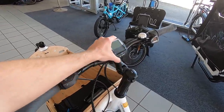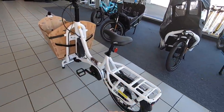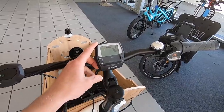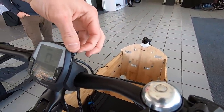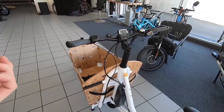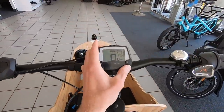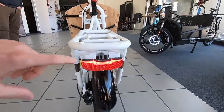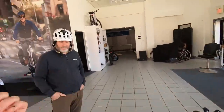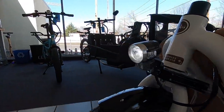These are some of the fancier parts on the bike that could be a bit more sensitive. I love that in addition to the motor, both the headlight and taillight run off the main battery pack, and they're pretty bright. Let me power it up quickly — it comes to life fast. This display has a micro-USB port on the side for charging an accessory, though it's only 5V/500mA versus 1,000mA on the new Bosch Kiox, meaning you can't charge some iOS devices. Press the light button — there we go, a couple LEDs, a nicer light positioned well out of the way.